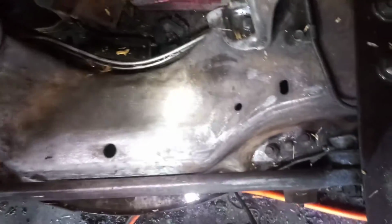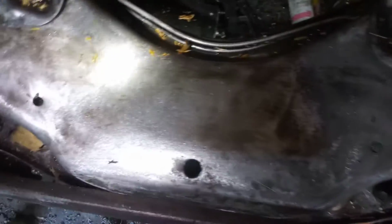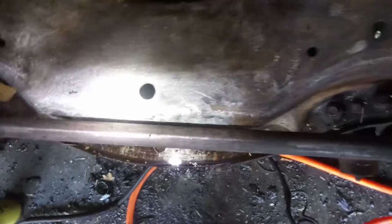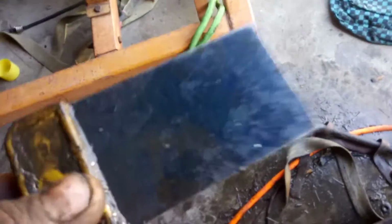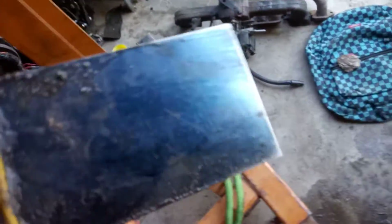It may not look like it because I don't have a light. But the paint, this is just almost down to bare metal here. And I don't want to just squirt, see, I had to get down in the cracks, man. You know, had the ball joints and everything else. Around all them screws, you got to get in there with a scraper, man. And I found a good tool, man. If y'all know what a metal Bondo blade is, it works great. I don't really prefer using these for spreading Bondo with. I like the plastic ones, but these work great for scraping gunk.